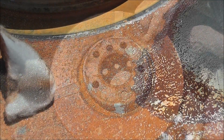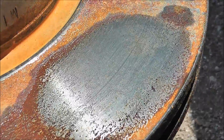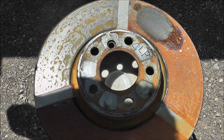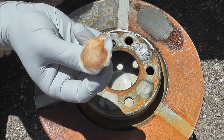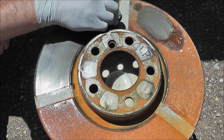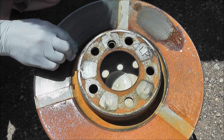Here's the area I just cleaned, and you can definitely see that it's pitted and etched in. That would require steel wool or a 3M pad or something like that to bite down into the metal — but at the same time we'd be removing finished metal. Now let's try the LTCI side. Oh yeah, this is much more superficial — this hasn't etched down into the metal. You can see it's just rubbing off — very orange. So yeah, there was rust floating on the surface but it did not penetrate. This is pretty cool. I'm enjoying this test — I did not expect this. I've been blindsided by this test a couple times.